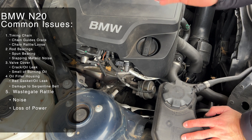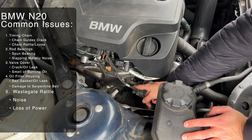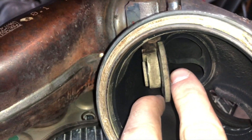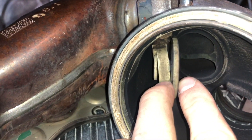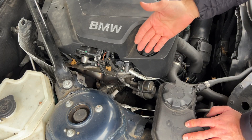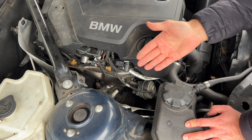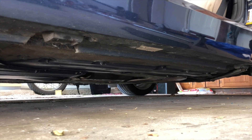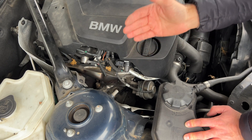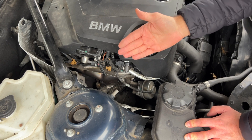This is a turbocharged engine, and as such it has a wastegate. That's the wastegate actuator that actuates the actual wastegate in the exhaust manifold down there. Unfortunately, the design of it allows the wastegate flapper to get loose over time and start making a noise. This wastegate rattle isn't a huge problem at first — it just makes an annoying noise, especially when you start the car. But the looser it gets, the more of an issue it can be, as it won't hold boost and the great performance of the engine.